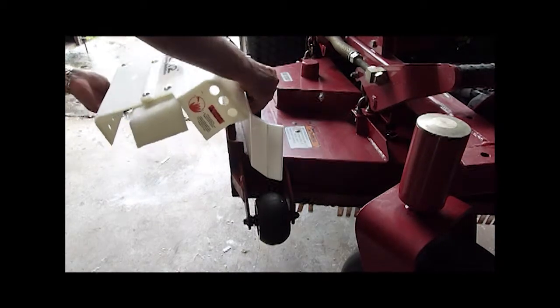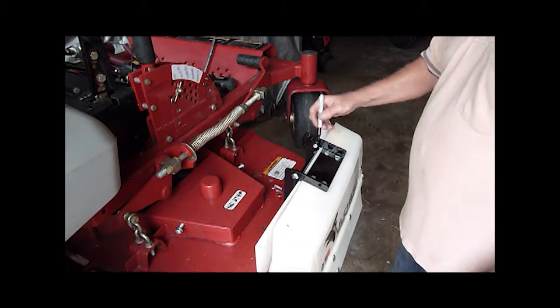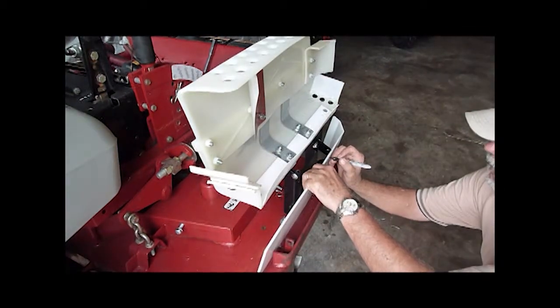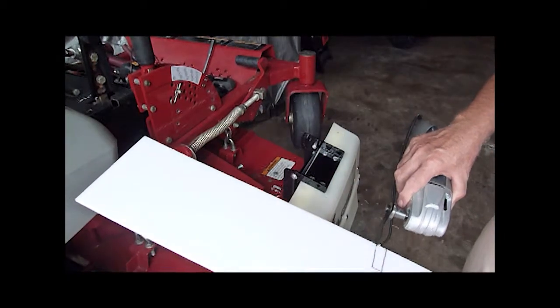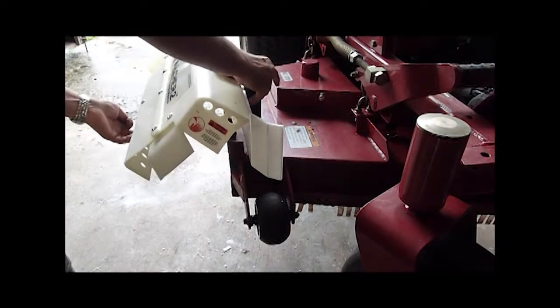Step 8. If you want the vulture arm to pass through the backing plate, a 1 and a half inch long by 3/8 inch wide slot will need to be cut out using a hacksaw or die grinder with a cut-off blade attached. Your vulture can now be manually positioned using the hairpin clip and hitch pin.